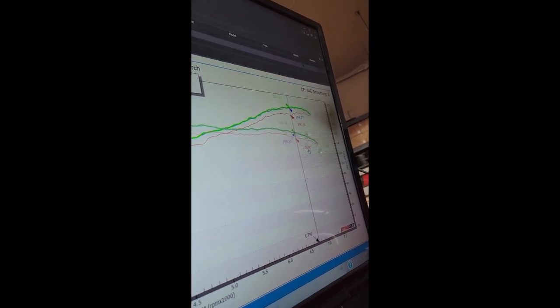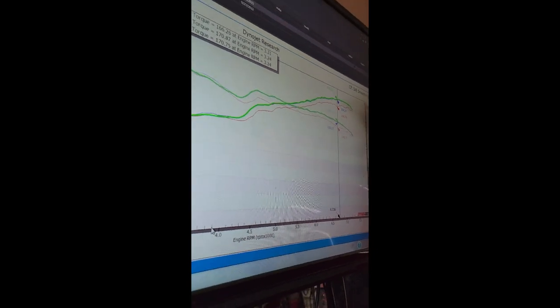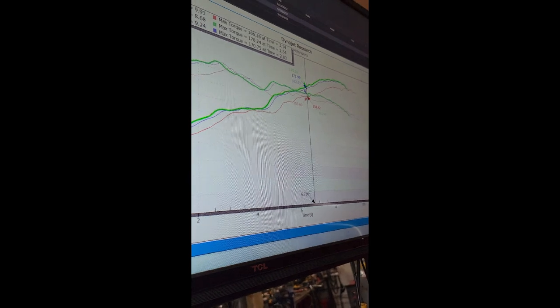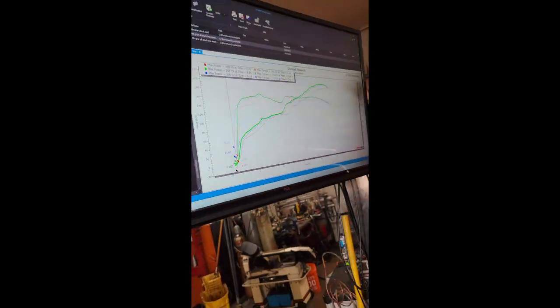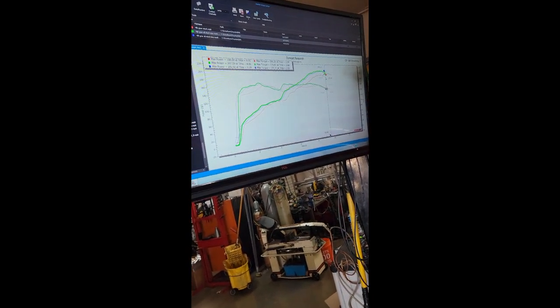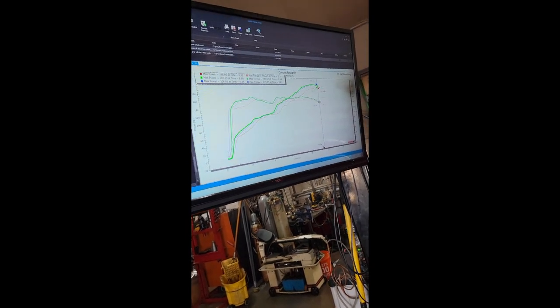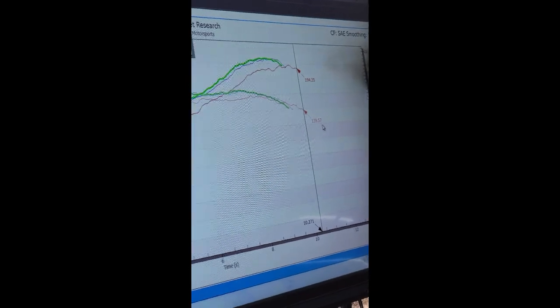Okay, so I've been doing both these pulls, been pretty close, so watch this. So to red line, and I am starting at about the same point. So we go, time to accelerate from fourth gear is 9.51 seconds versus with the filter out, 10.2 seconds.